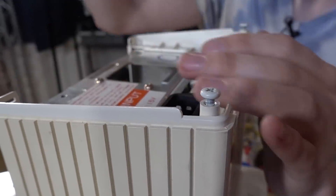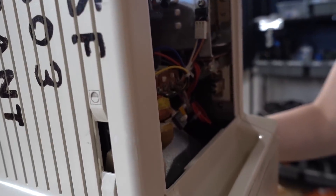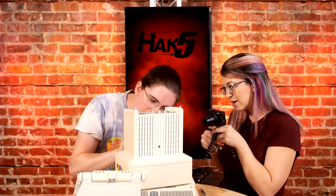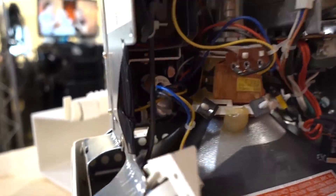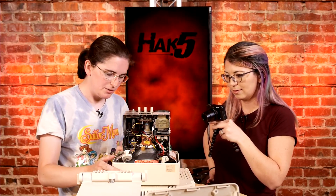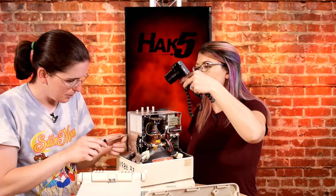I think that's all of them. This can go first. That is actually really nice and serviceable. There's screws under that one too. Made in Korea — that's interesting. My years of building computers pays off. There we go. That's a piece of plastic that does not look all that bad. However, I think it would be nice to clean that up because there is some dust in there. If we're going to be repairing this, you can see all the capacitors inside of there. You would desolder them by removing this. Don't touch any of this if you don't have to, because when I remove this there's going to be possibly a couple thousand volts, especially on the flyback transformer.